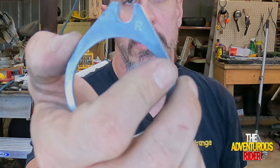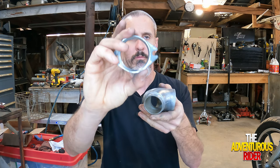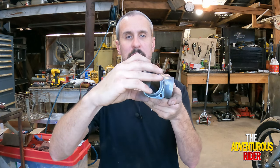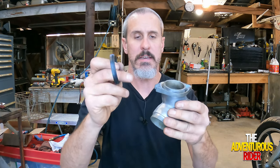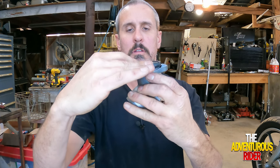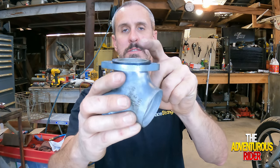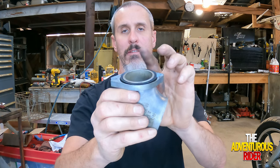This one has an 'R' for your rear cylinder. With the carburetor facing the way it'll go on the bike, you want your rear cylinder flange on like this, with the little ear facing away from the carburetor. Then you have your gasket — there's a groove it goes into with a beveled edge. As you put it on, you want it to stay as flush as you can with the outside, so when you tighten it up it'll tighten against your gasket and give you a good seal.